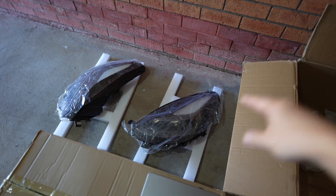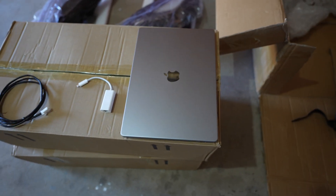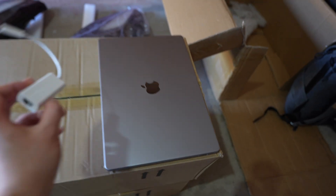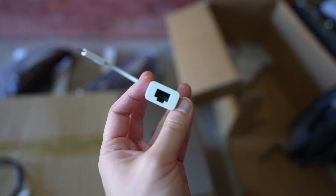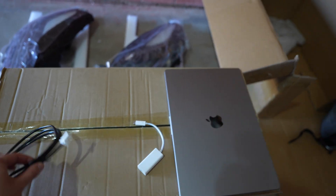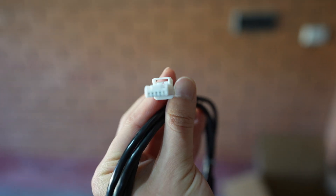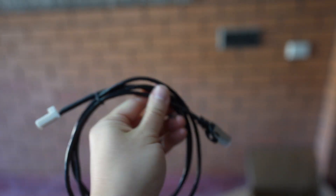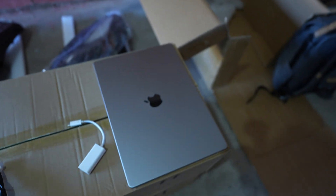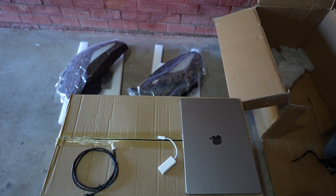So to do the retrofit, obviously you'll need a pair of Matrix headlights. You'll need a computer, preferably with an Ethernet port. If it hasn't got an Ethernet port, then just get an adapter like this one here — a USB-C to Ethernet adapter. And if you have a 2019 or older Model 3 or Y, then you also need this diagnostics cable. This converts this plug here to an Ethernet plug on this end, which we'll then use to connect the car to the computer where we'll configure the headlights. All the links for everything here will be in the description.